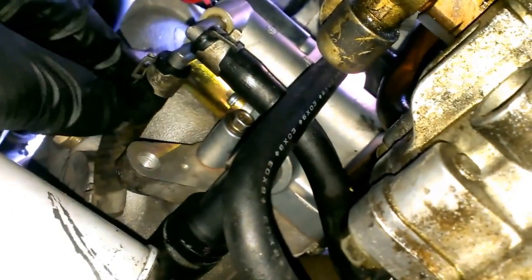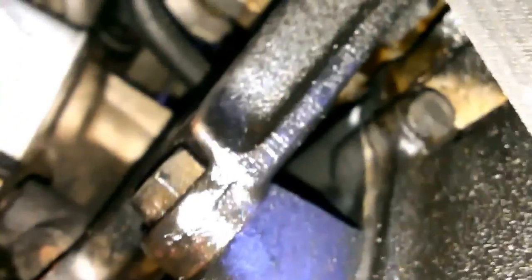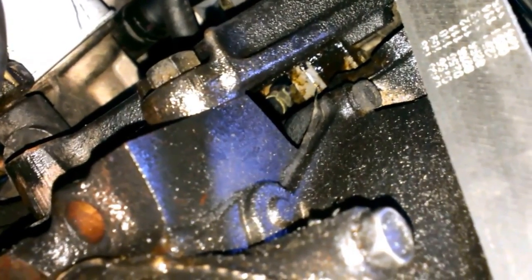Alright guys, I'm back at the bottom part of the car again. I got everything connected — got these little coolant lines back on with the clamps and got the bolts back on. Hopefully you can see everything. I got the bolts back on at the bottom there. I'm eventually going to put some kind of clamp for this thing and I'm going to leave the bracket off for temporary reasons. We're about to reconnect these connectors — one for the idle air valve and the other one is for the coolant temp sensor. Once you've got it all back together, go ahead and make sure you put some coolant in, fire it up, let it warm up, and see how everything goes. I'll be back after I finish connecting everything and putting the coolant in.